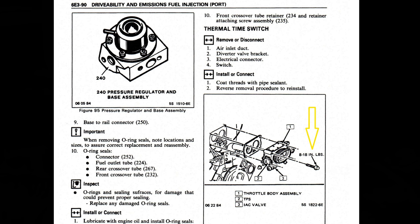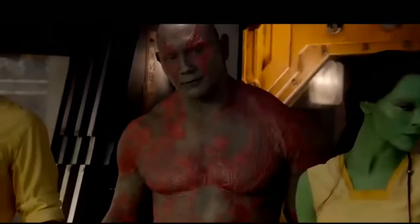After doing some research on the throttle body's torque specification, it turns out the factory service manual was incorrect — it's actually 18 foot pounds of torque, not inch pounds. So it's okay to question something, but just do the research. In this case, I came out ahead.